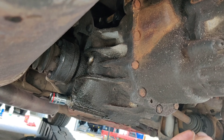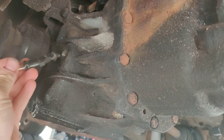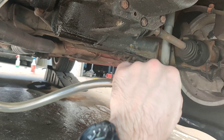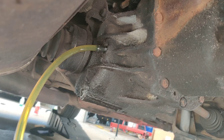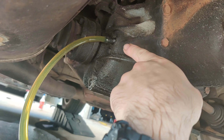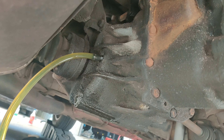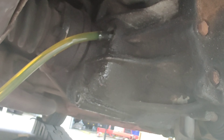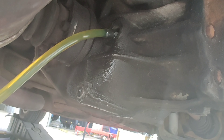Moving on to filling — the bottle is filled as high as we can, which is less than a quart, so we'll have to refill it several times. We stick the pump end into the fill hole and pump, watching the fluid travel up the hose line and into the transaxle. We keep going until we see a slight dribble. I went real slow at the end since I knew I was close to 2.75 quarts, and I had about a quarter quart left out of my three — the shop manual was very spot on.